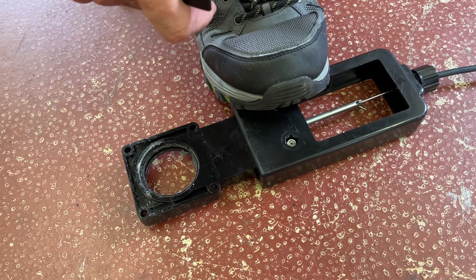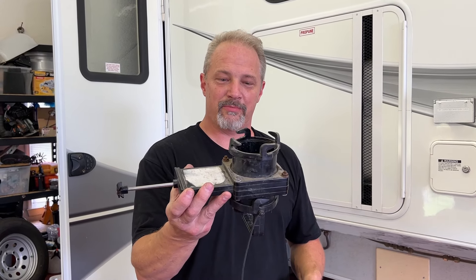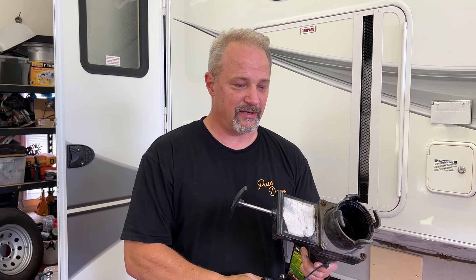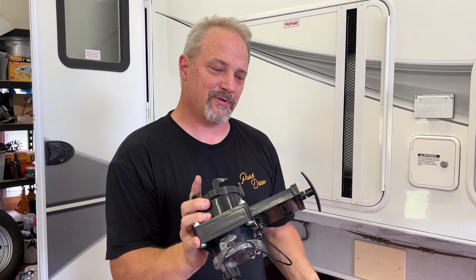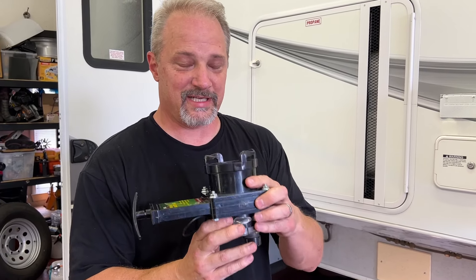So this is the old valve — when I push it in, it doesn't quite close all the way. On the camper it came with one of these extra valves that screws onto the bottom of where you screw on your drain hose, which adds a third valve other than the black and the gray. I always carry a brand new spare one just in case. It's a Valterra twist-on valve — I'd highly recommend getting one of these and having it with you, because if one of your tanks leaks especially the black, you can screw this on, shut it off, and you won't get fined a thousand dollars by the park. I'll put a link below.